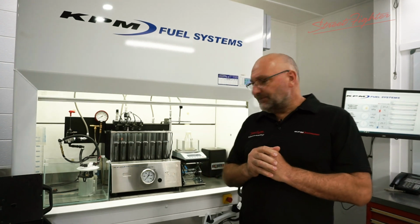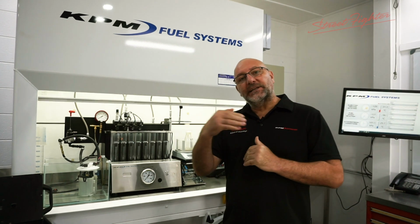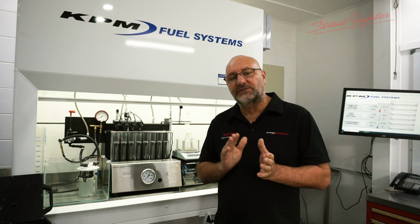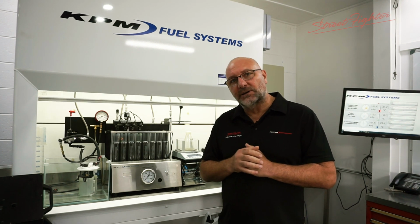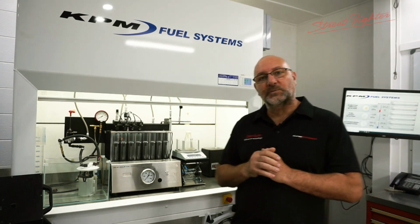Now, just to finish off, that is 700 horsepower petrol. If you're running ethanol, it equates to about 550 horsepower on ethanol, roughly around 350 rear wheel kilowatt on ethanol, 450 flywheel kilowatt on ethanol. So just be aware, we're rating this at 700 horsepower petrol, but able to supply ample power for your Rexy, your Liberty, your Forester, your STI.